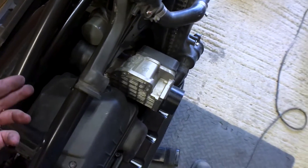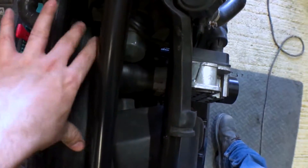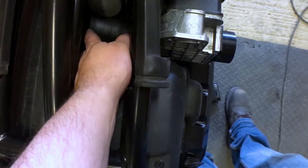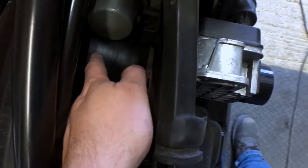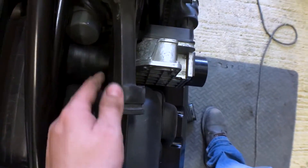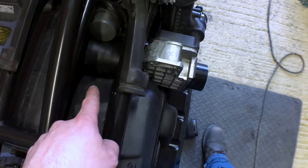So I've taken the tank off and taken the electrics tray out so we can see what the issue is. The plenum chamber can't move — there's no movement on that whatsoever. You've then got this rubber coupler. I can't remember the size of this now — I'll try and put the size on the screen. You can buy them readily available off eBay. It's like a 70mm to 60mm or something like that. So this is probably the distance we need to take off. What I need to do is find a way of actually moving the air filter to connect to the plenum without using the coupler or using a smaller one.